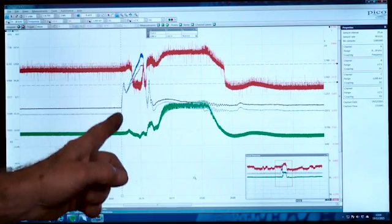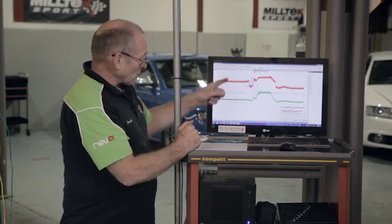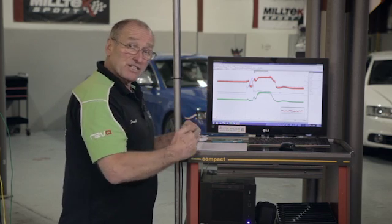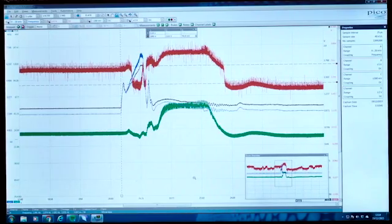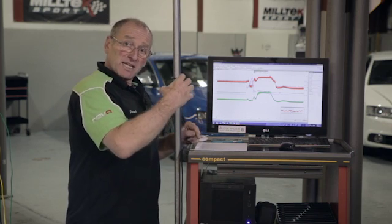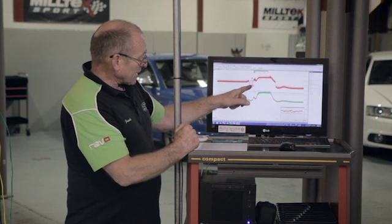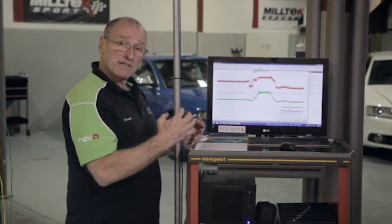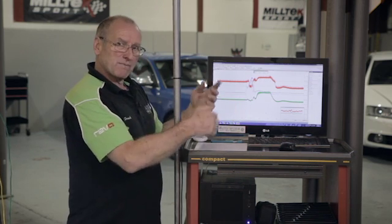With the voltage, when it goes negative downward, that's a deficiency of oxygen — that's extra fuel being added. When it goes up, that represents throttle off — the injectors are turned off. So this big deviation upward is reporting the excess oxygen in the cylinder when there's no fuel being delivered. The enrichment is actually quite subtle with the wideband sensor because its performance balances the fuel requirement out quite accurately. We can see it better on current — we'll come back to a full description of current.